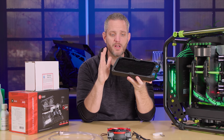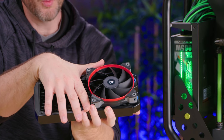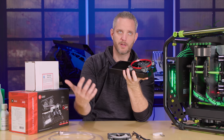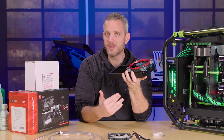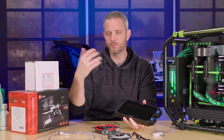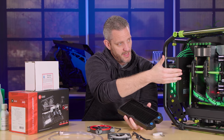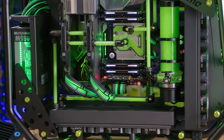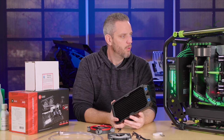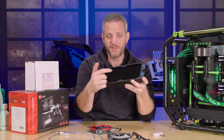What I like to do is take about 120mm — that's one 120mm fan worth of radiator — per component. This is why you see 120s being used all the time on CPUs and all-in-one water cooling loop powered GPUs, because a single 120 30mm rad is usually more than enough to handle a standard component and even a little bit of overclocking. Now when you start stacking components in your loop, adding more GPUs and CPUs, it gets more complex. In this case we've got two GPUs and a CPU monoblock, which is also touching the VRMs, which get very hot.